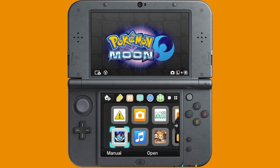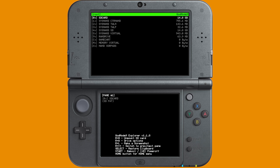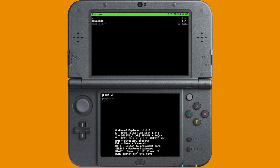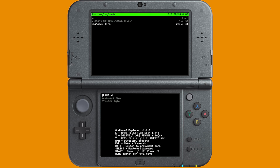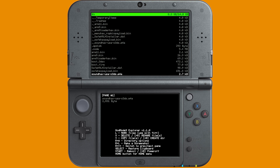Once you get to the home menu, go ahead and power off your Nintendo 3DS, and then turn it back on while holding Start in order to get to GodMode9. Once you're in GodMode9, press A on SD Card, then scroll down to the Luma folder, and select the Payloads folder. In this folder, we're going to go ahead and delete the start_SafeB9SInstaller by pressing X on it, and then A to confirm the deletion. Once you've done that, press B to return to the SD card, and scroll down until you see the boot.firm file — copy that by pressing Y on it.